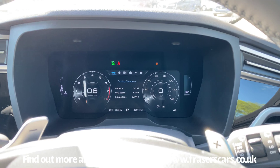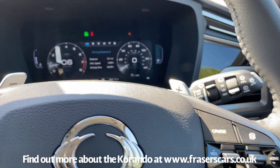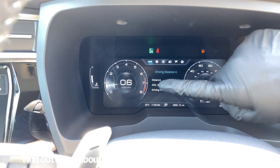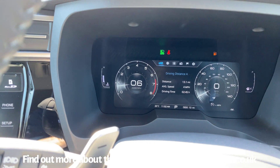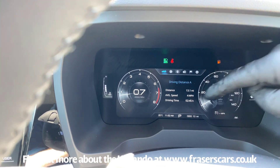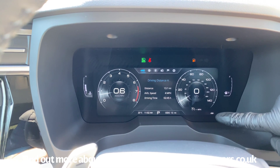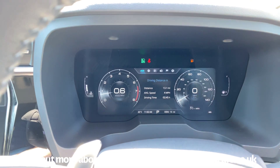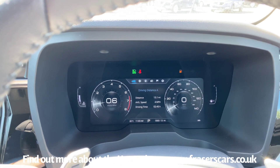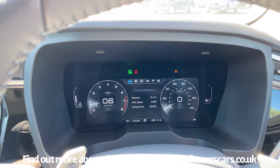Now through the instrument cluster. To navigate top menus we use this button, and for sub-menus we use this other button. On the right-hand side is your fuel gauge — the car's low in fuel now so the fuel light is on; when full it shows bars, just like the temperature gauge on the left. At the top are information lights — fuel light, seatbelt reminder, high beam assist active, lane departure warning active at the bottom right, and cruise control on standby. Along the bottom is outside temperature, time, gear position (showing Park as it's automatic), and the odometer with total mileage.